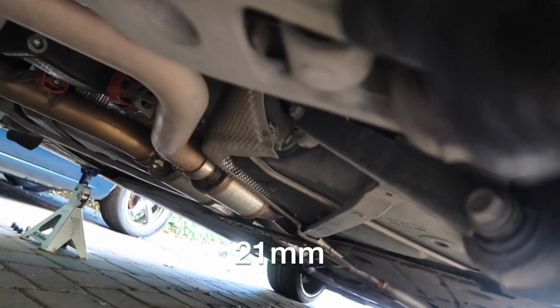Got my little chair. One is gonna be for the shock. This is the rear shock. Second's gonna be for the rear hub. So what this does, you loosen these 2 bolts, it allows this lower control arm here to lower down to get this guy. This is the rear spring. We're gonna lower it down, get the spring out, put the new spring in, boom, that easy.